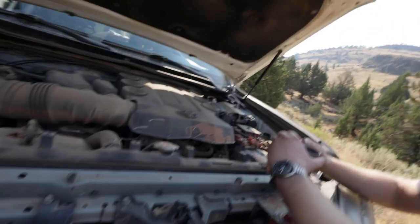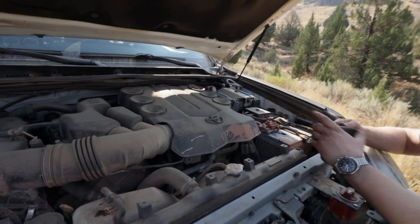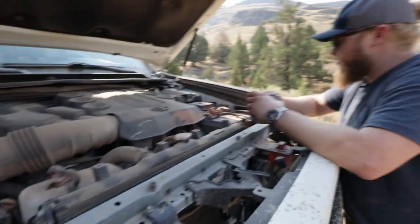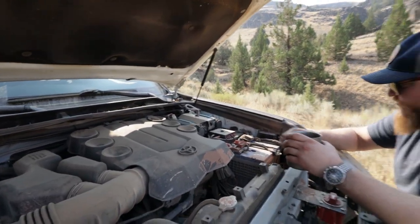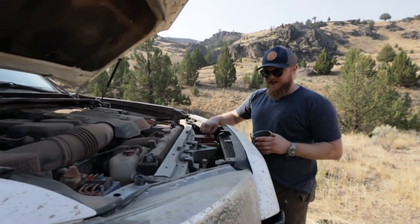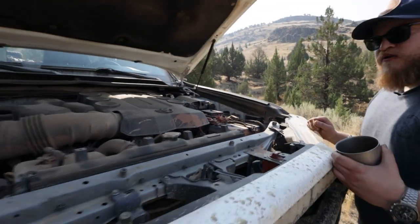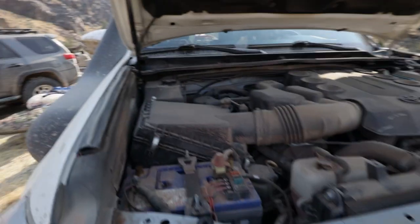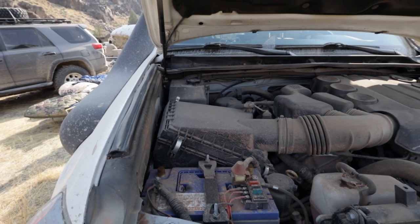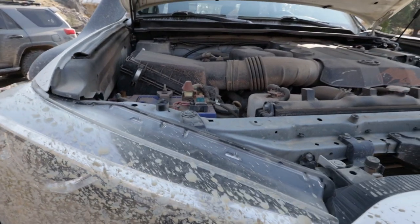Yeah, so we've got the Redarc DC to DC charger that maintains proper voltage to the auxiliary battery. We've got the S-Pod, which you saw. The light bar goes straight from the battery, ditto with the winch. I've got a battery switch for the winch for safety purposes, because if you're in a collision, you're not going to have something short out. Otherwise, pretty straightforward. And you relocated your windshield washer fluid? I did. That was Schrockworks, I want to say. Yeah, out of Texas. It worked well.